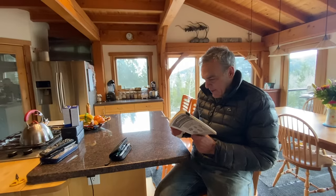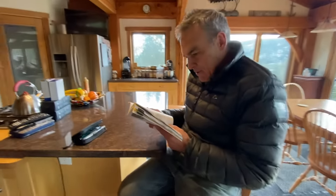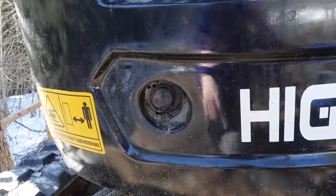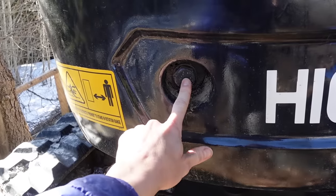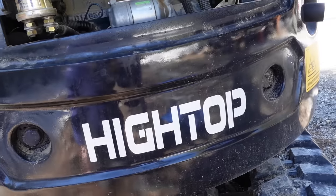One other thing it could be is the voltage going through the glow plugs. If the voltage is low on the battery, that could be the issue. We've confirmed there's fuel going in because we loosened the injectors and fuel was coming out, so fuel is fine. The air is fine — it's brand new. So it's got to be the heat — it's got to be the glow plugs. The battery is down there and it looks like the only way to get it out is to take this panel off, so we have to go get the right socket size.